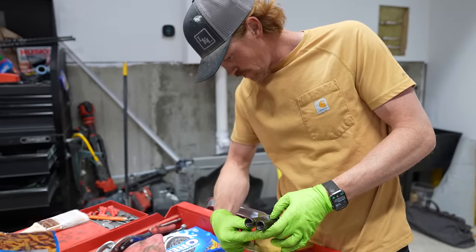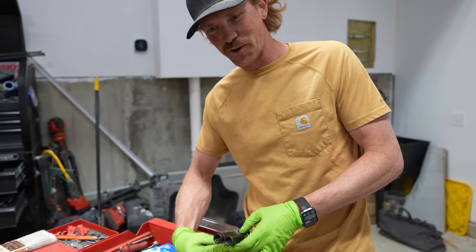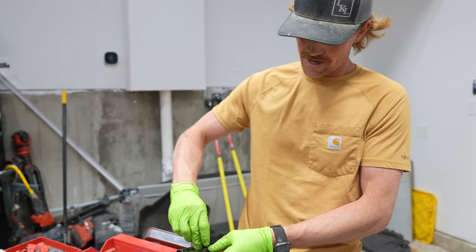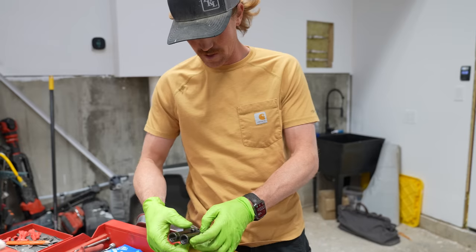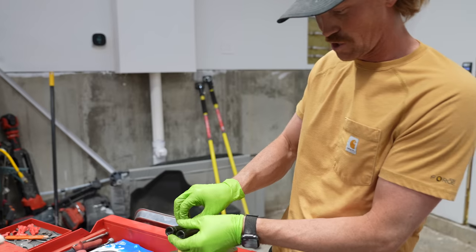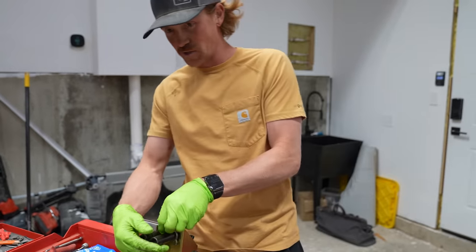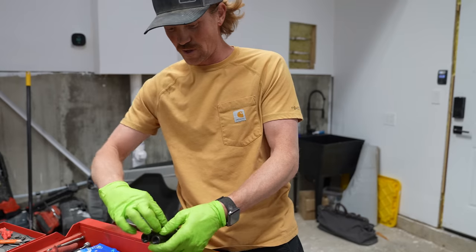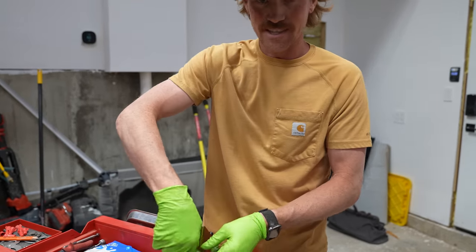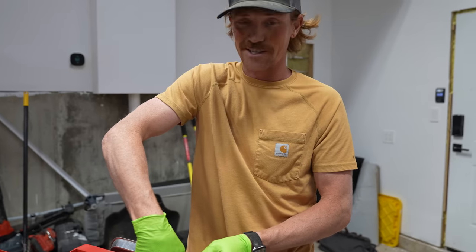Getting it figured out. Well, now that I've put this together about six times in the wrong configuration, I think we're finally figuring out how everything here is supposed to be mounted. I'm gonna finish getting this shifter installed, get the cables attached to the actual shifters. Then I should be able to run the transfer case through its gears, make sure everything's working. And if that's the case, we'll be able to get it put on the transmission and get back to step one.